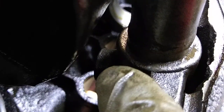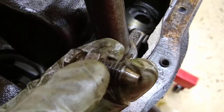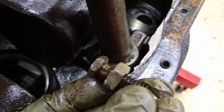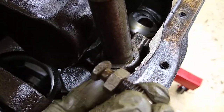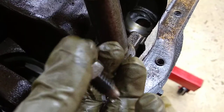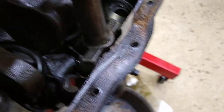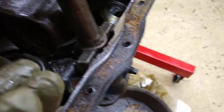It's real simple. You can see that little protrusion right there. You've got this bolt and lock nut that thread in there, so you're going to want to loosen the nut, back it off a little bit, and then you'll be able to back this set screw out. That set screw rests in a hole in the shaft of the oil pump, so you just back this out all the way.